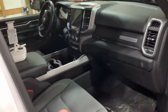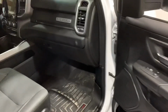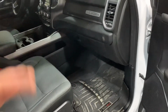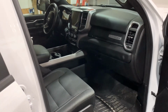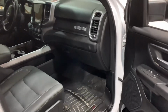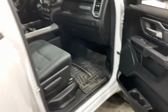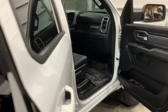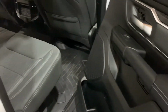And with that being said, where I used to keep my volume control around 20 for driving, if you were to put a lower decibel speaker in, your volume would have to go higher to compensate. So where I used to be at 20, I would probably be closer to 30. With these speakers, they need little power with that rating being so high. They're just a very well-composed, efficient speaker. But that's one of the top reasons why I picked the Infinity speakers.